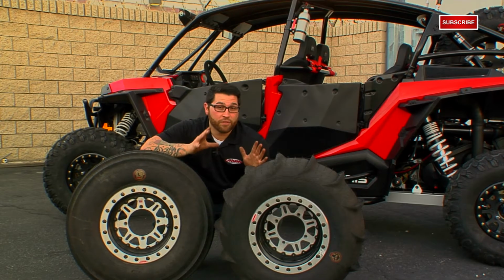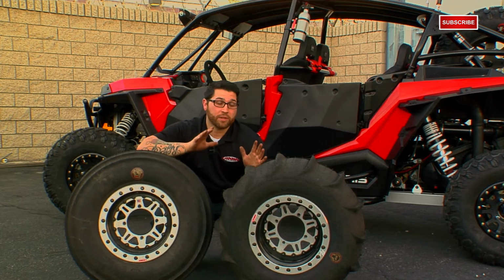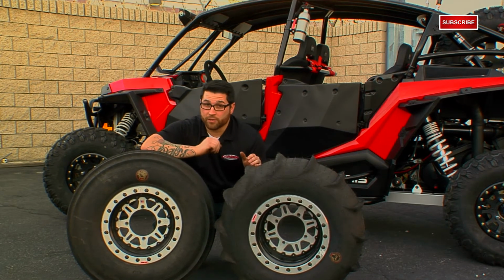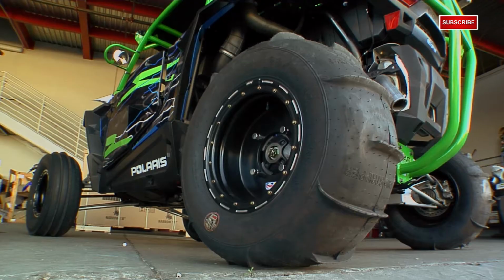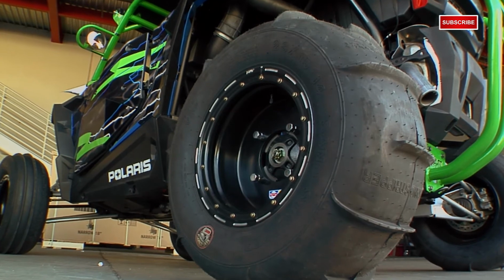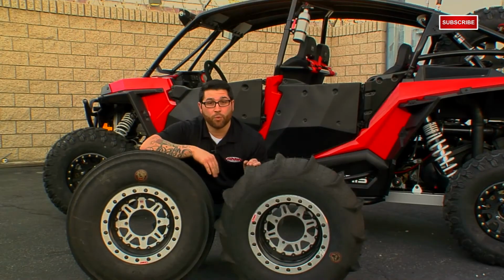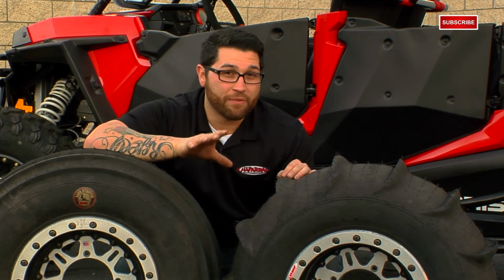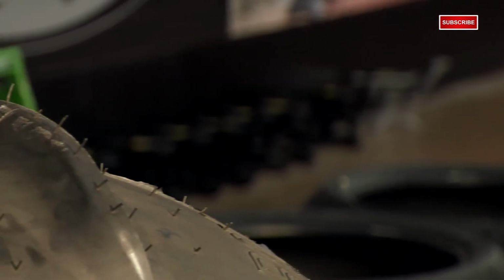As for sand tires for your side-by-side, you can't go wrong with the complete set of GMZ Sand Strippers. Now the rears come in two models, standard and the HP version. The standard was primarily designed for cars 900 ccs and lower with a staggered paddle, so you can have some fun whipping it around but still offers great straight line performance. Whereas the HP model was primarily designed for 900 ccs and above with a full 1 1/8 inch paddle that makes climbing dunes much more exciting.